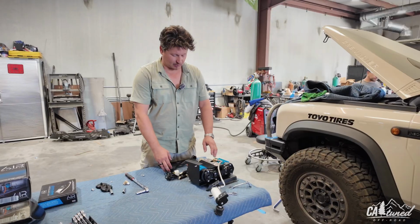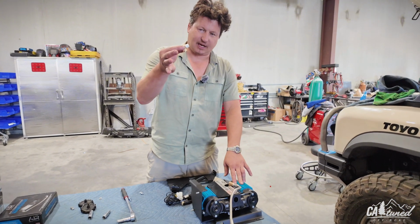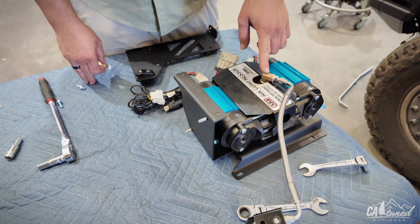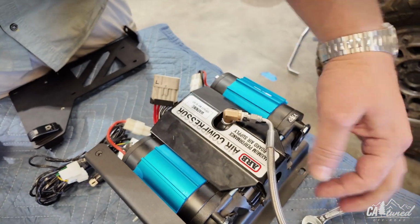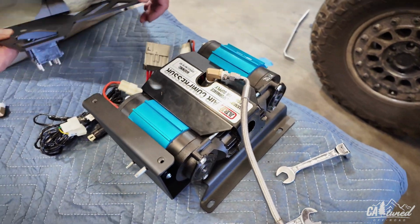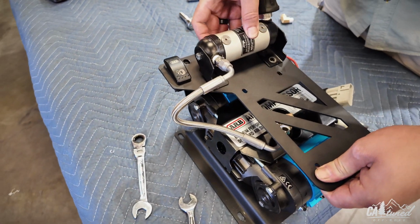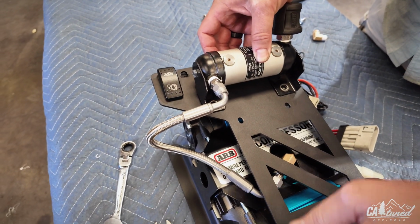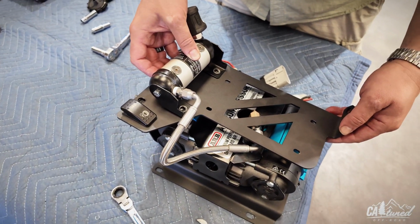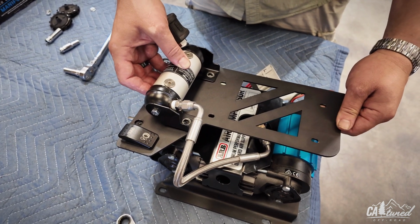Let's do that. Alright, once you got the compressor installed, I want to show you an important thing. You'll have a 90-degree male-female end that you're going to screw into the compressor side. Make sure when you have everything connected, if this is 12 o'clock here, you're looking at about 11 o'clock-ish, have this pointed to. That way, when you install this at the end, and you put this reservoir here, this muffler, it's not kinking, it looks really good. So if you want to pause this video and look at this angle, you guys can do so. Just remember, around 11 o'clock, this is coming out just like that. Bam, bam, boom.